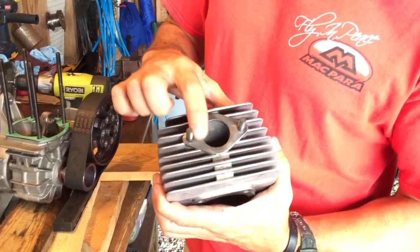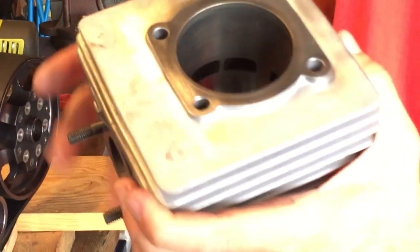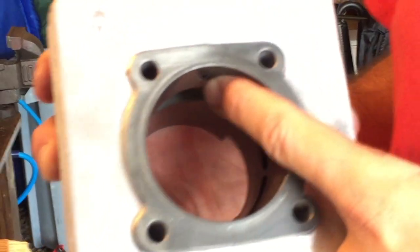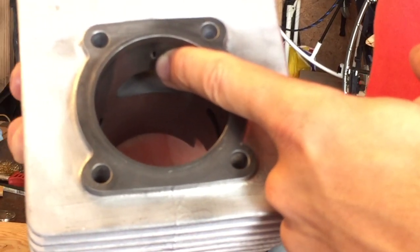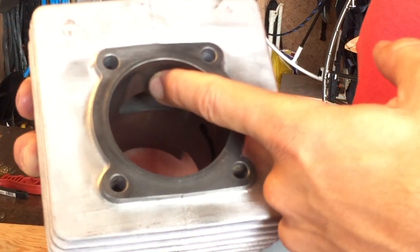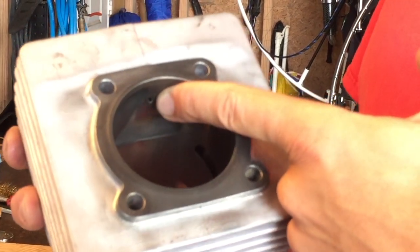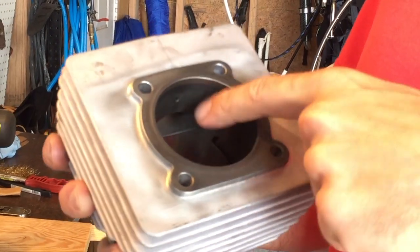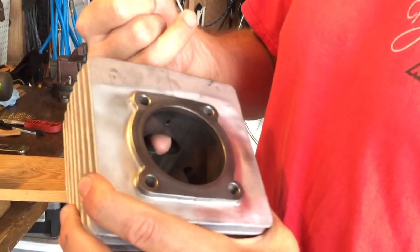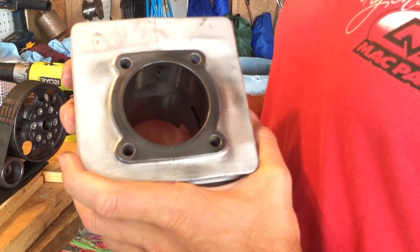Then make sure you clean up the exhaust really well and actually get inside of there and remove the carbon. One of the most common misconceptions is that inside of the cylinder sleeve there's a little tiny pinhole, and that pinhole is for your back pressure, your pop-off pressure, inside of the compression. If you're pulling and pulling and it's not firing within the first or second pull, that little hole gets filled with carbon, and that hole vents through the exhaust. That is why it's not firing, because you don't have that back pressure in there.